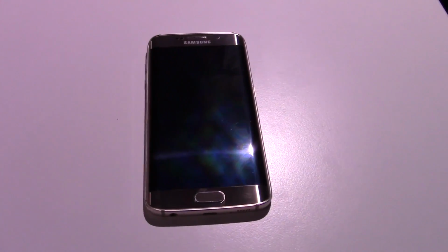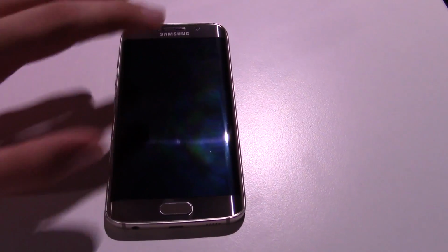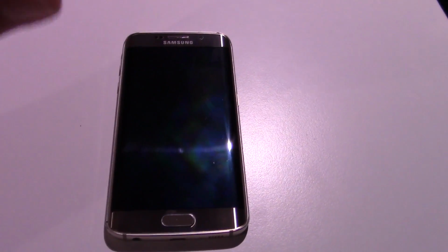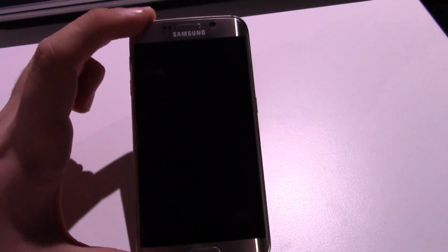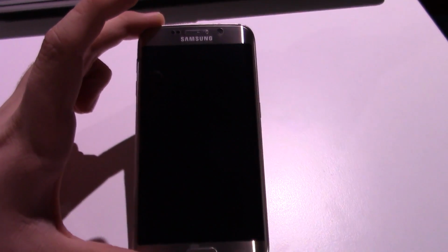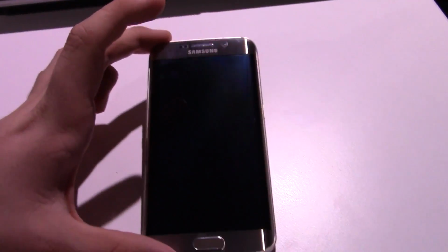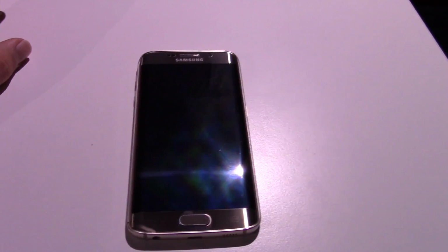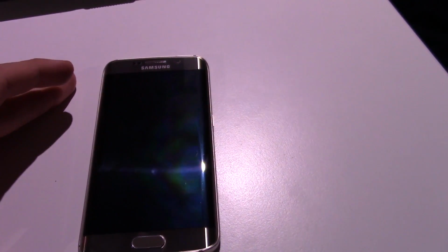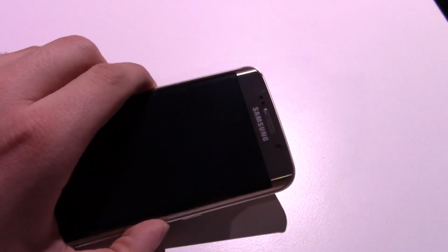Since then, he has already disassembled it. He's soaked everything in alcohol, the parts in like 99% alcohol. As of now, the only thing that is not functional is the AMOLED display, which does make sense given that AMOLED displays are not very resistant to water. They do not like water at all, and when they come in contact with water, they usually break, unlike LCDs. So that would make perfect sense. This phone needs a new display, obviously.